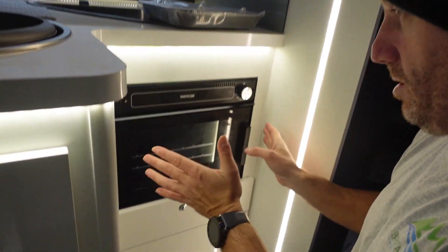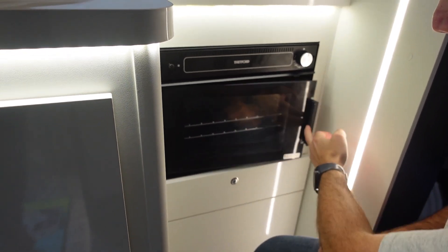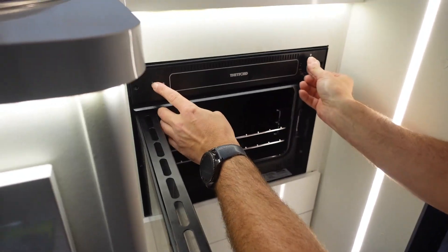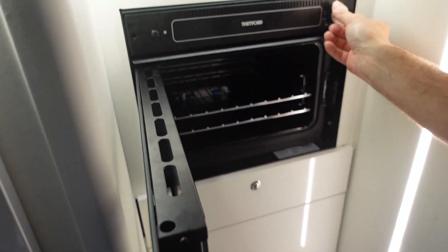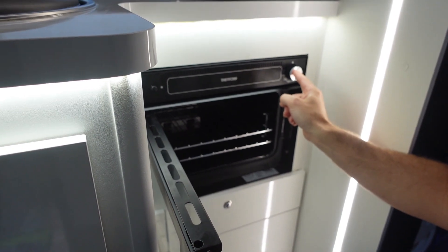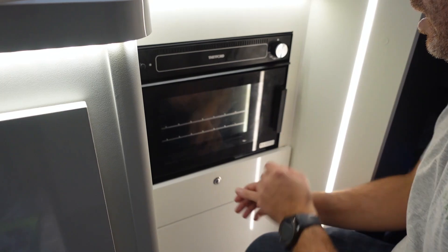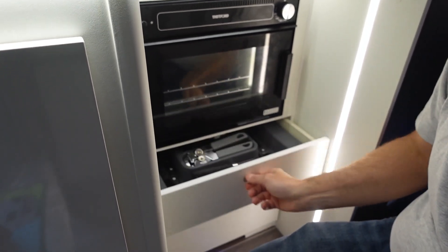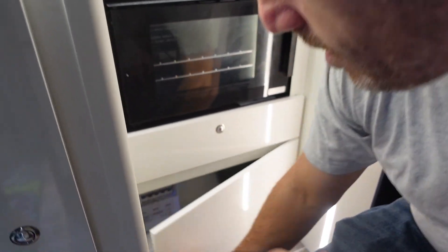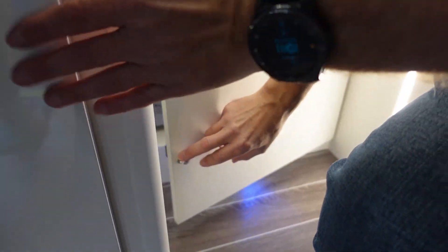On the Madison Marie you have a different oven to what's on the Kayla Louise. Just grab the handle at the side and it'll open. Hold it in, turn it round, then spark and it's away. There's no grill function on this one, just an oven. To turn it off, knock it round so the little black lines are pointing upwards and you'll see the flame go off at the back. You have a drawer underneath with cutlery in. Underneath here is where the 240-volt trip switch is on this model, whereas on the Kayla Louise it's in a cupboard.